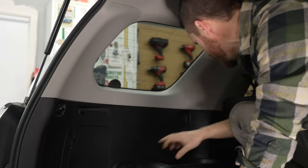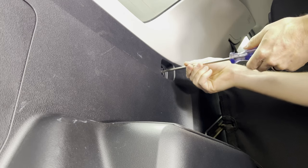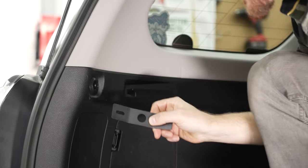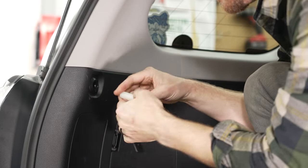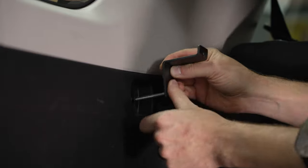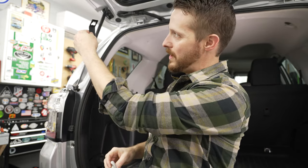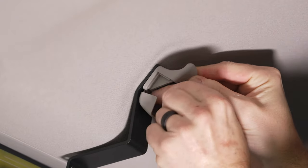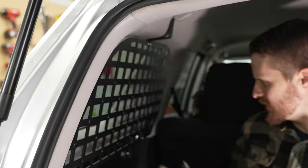To install, remove a hook and a bolt here. Take the bracket, put it in place, thread the bolt in the hole but don't tighten it yet — we'll tighten everything up a little bit later. The next bracket goes in with its bolt and spacer. For the top bracket, it goes against the roof, and you take the hook — it can only fit one way, which is really cool. Use the original OEM bolt, attach it, secure it, and cover with the little flap. Attach the new panel using the supplied hardware, tighten up all your mounting brackets, and you're done.